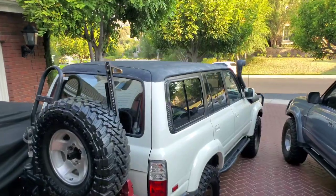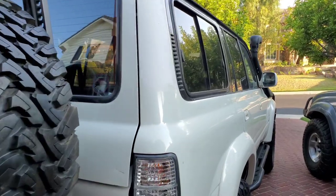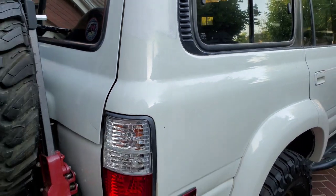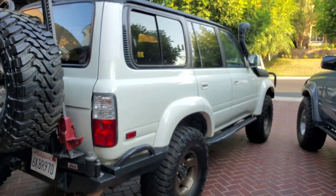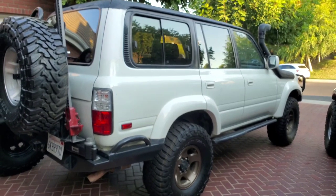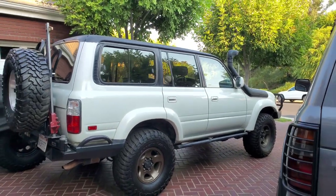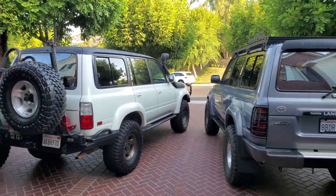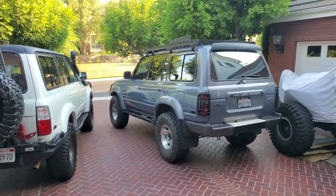One bummer on this truck is the previous owner painted the roof. This paint is a one-coat process, which is phenomenal — it can oxidize from the sun, but the upside is you just grab your pink polishing pad and compound and buff it right back to showroom shine. There's no separate clear coat; the clear coat and white are mixed together. So if you ever get your hands on a white Land Cruiser and the paint looks chalky, faded, no mirror finish, don't worry — you can polish it up and it will look phenomenal.